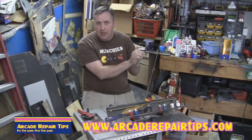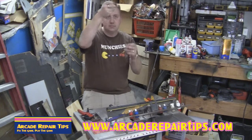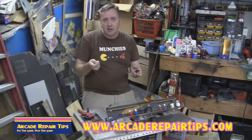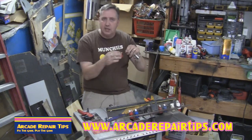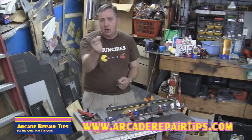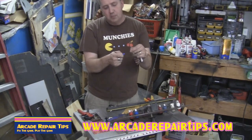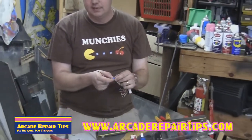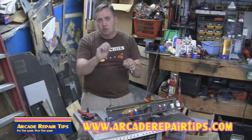At the end, this one happens to be black. We can strip one of these wires — I've already done that — and take a long black wire. You're going to need to make sure your wire is really long; you'd rather have too much wire and cut it off at the end than not enough. You can go in there and solder it, put heat shrink over it, and make that look nice. Or, here's something maybe we haven't showed you — this is called a butt connector. It's a cylinder with two empty ends. All you do is put one end in, crimp it down, put the other end in, and crimp it down — it makes a connection. A lot of people don't like to use these, but it makes things easy, especially if you're doing a repair on the fly. If you have the time it really is better to twist them and solder them.